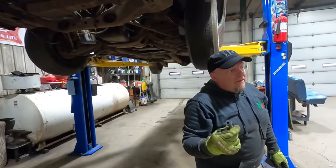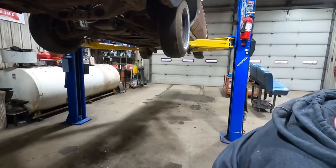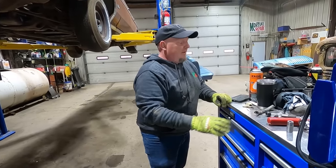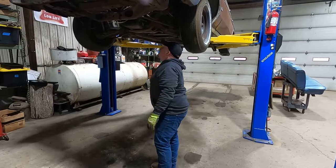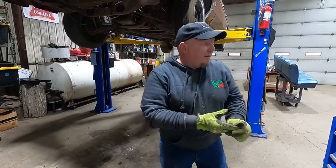Now snap the fuel pump right off the block. No. Rotten hose breaks every time. Now all we need to do is get a chunk of 3/8 hose. Wow. We're ready to go. Brilliant. Let's set it on the ground and see if it turns over and has spark first. Yeah, that would be a good idea too.